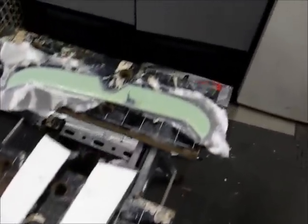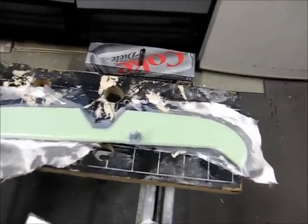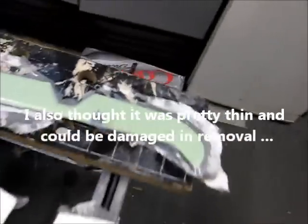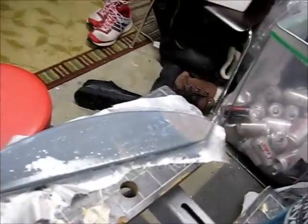I've done some glassing on some of the control surfaces — the ailerons — and I've actually taken the horizontal stabilizer and elevator, separated them from each other. You'll notice I'm cheating a little bit on the aft portion of the plane; I'm actually not removing the skin on this little area here. It didn't seem like it was really going to be that necessary — it seemed like it was actually pretty light already. This is a small part so I'm not too worried about it.